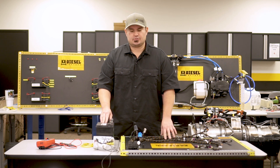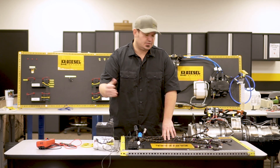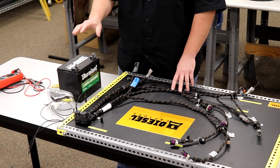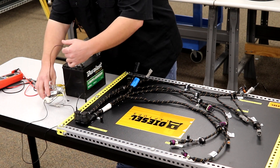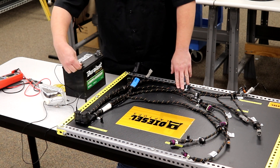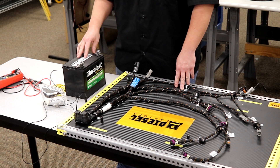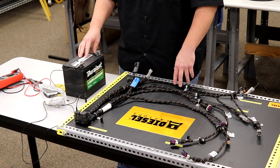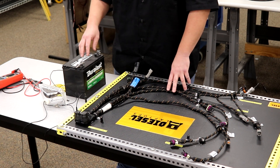So let's go back to the original pins that we started with to test the first one, which was two tenths of an ohm. To do the load test, all we need to do is take our halogen headlamp. We need to take one side and go to the positive side of the battery. Now once we've done that, in order for this light to burn, the only thing that we need now is ground. So to provide that ground, we're going to use the existing harness so the current moves through it and load tests that wire.